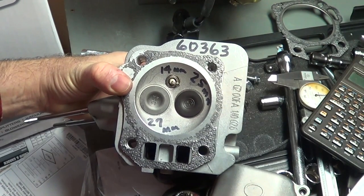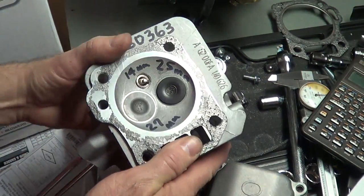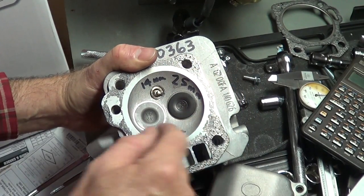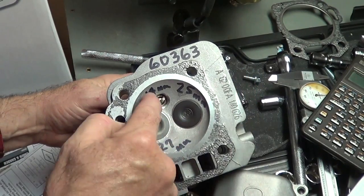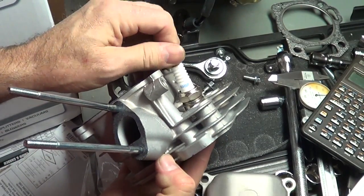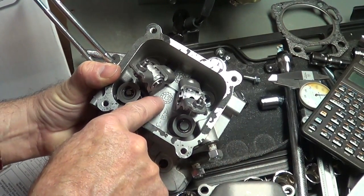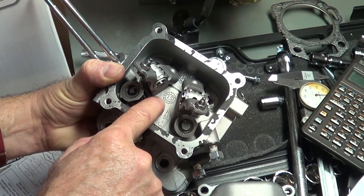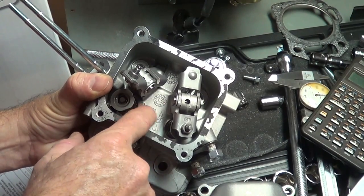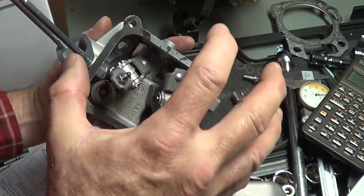One of the forums said the valves were actually smaller originally. These scratches on here are just me playing around — there was a rough burr around this edge that I went through and just kind of cut off. There was also a slight burr right here where the plug hole is, and I went ahead and knocked that burr off just for good measure. Of course it's got a 14 millimeter plug on here. There's the stamping on the casting — it's 13 with the date. Generally they have dots; they go around and stamp when they did a modification to the die, or sometimes they do that for the run. There's a 13 and a 14 — it might be because there's two different inserts on this with different dates. This is pulled out on the mold.